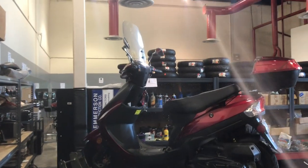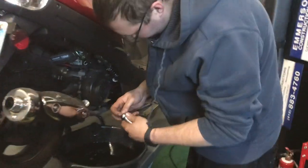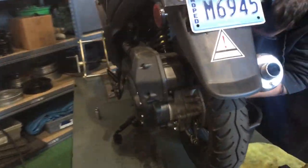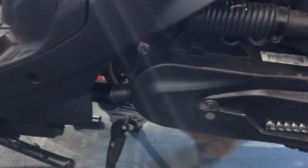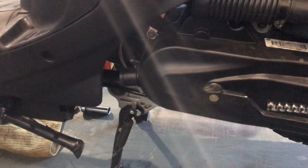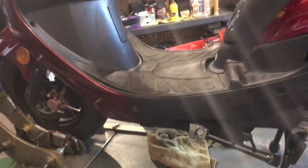The service requires you to go through the entire bike, including an engine oil replacement. The gearbox oil also has to be changed — the gearbox is right over here. The crankcase cover needs to be removed as well, and that has to be completely gone through: remove the variator, remove the clutch, regrease the sheave on the clutch, and reset the rollers, cleaning out the inside.